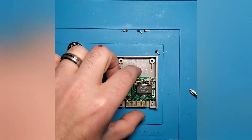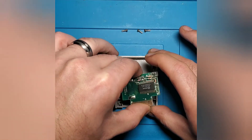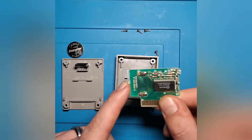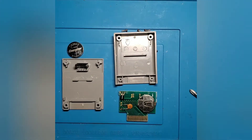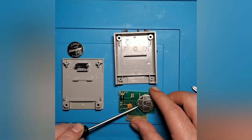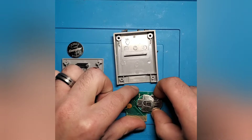On the bottom side of this main board is actually where the battery is housed, so you just lift the main board up. There are a couple of little posts up here towards the top to help hold the card into place, and it looks like they put a little bit of hot glue on either side to keep it from moving back and forth inside the card. Now the cool thing about these larger cards is that the batteries are actually in their own holder — they're not soldered to the board, so these are a lot easier to change. What I like to do is use a small flathead screwdriver, stick it right up where these two cutouts are, push the battery towards the edge of the board as it slides out of the holder, and then remove the battery.